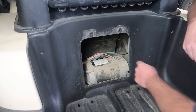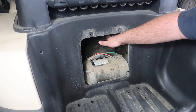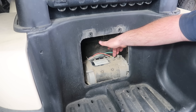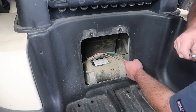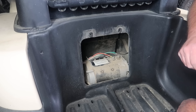There's going to be a green and a white wire — both of those use a half-inch fitting. The white wire is actually on the front of the motor. The orange and blue wire are 7/16ths of an inch. The blue wire is on the front of the motor. On the passenger side of the motor here is the speed sensor, and you can see back in that corner there is a harness we need to disconnect.